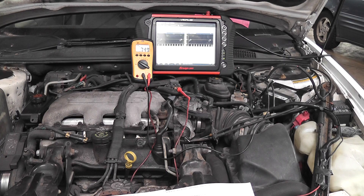We're going to do a couple things. We're going to use the scan tool, bi-directional — command the valve to open and close and listen for a rough idle. That would be one method. The second method is how to do it manually with a jumper wire safely, showing you how to read the wiring diagram, whether it's power or ground side switched, and also how to monitor the EGR valve position using a volt meter. We're going to do a flow test on this car, starting with bi-directional.